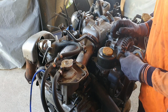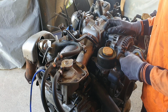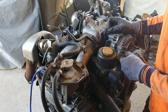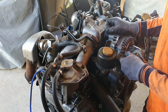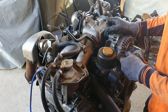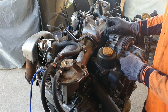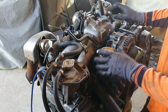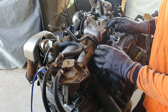However, the Rally Sprint car is a 98 shell, and this is a 93, or version 1 or version 2 engine. And there's a few differences with that. So basically we've got to use the complete wiring loom, the dash and ECU and a few other bits and pieces, intercooler and everything, out of the 93 or the version 1 car to make it all work without having to rewire everything and change everything over. Subaru pretty much used this same setup from the Liberty RS or the Legacy RS, depending where you are in the world, all the way through to 96.